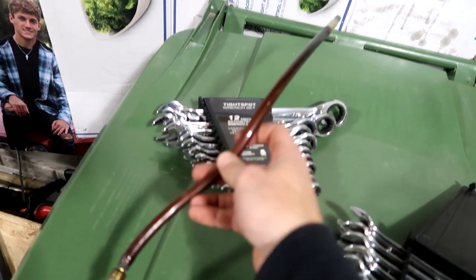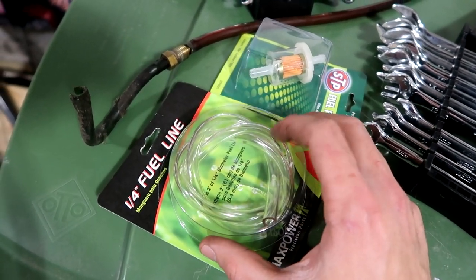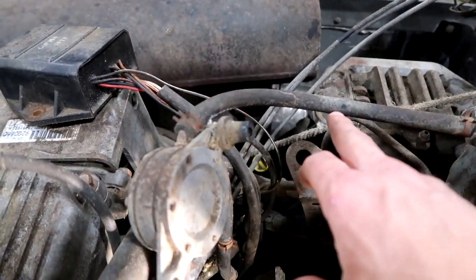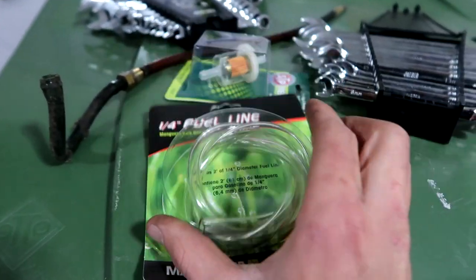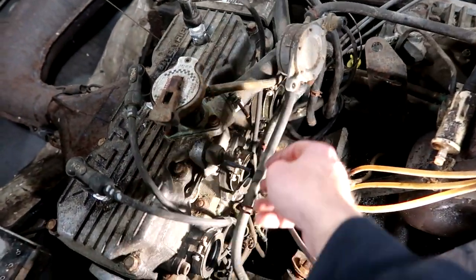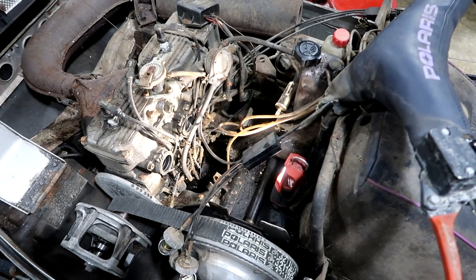Since the fuel tank pickup was good, I'm throwing that back in. I also bought some nice clear fuel line so I can watch to see if it's pulling fuel from the tank, along with a new fuel filter because the old one doesn't look too good. I'm also going to replace a couple of the fuel lines, though I didn't get enough to replace the ones going to the carburetors — I'll order more fuel line online for those. For now they're going to have to stay. I'll get all those swapped out.